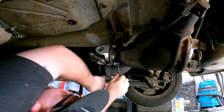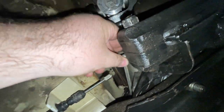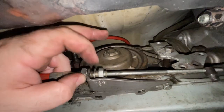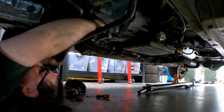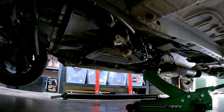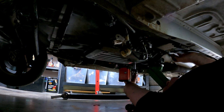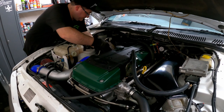First few things being removed, the tail shaft, the starter motor. The handbrake cable needs to be removed because it runs between the trans mount and the output housing of the BTR. Undoing my manky homemade B&M shifter bracket, removing the flex plate bolts next. Dropping the rear of the BTR so I can get to the top bell housing bolts. But I'm about to discover that my dump pipe is in the way, so I'll have to remove that as well.